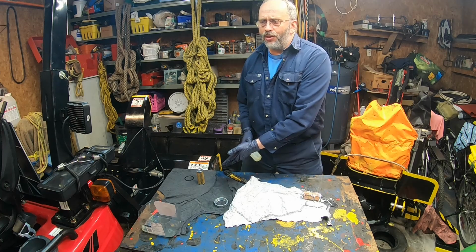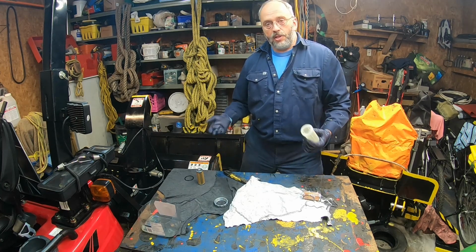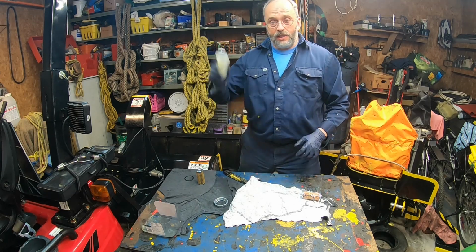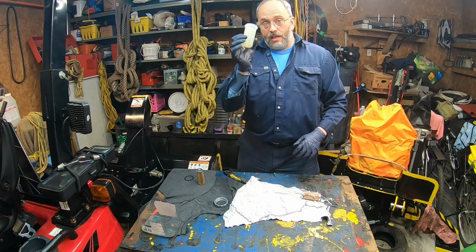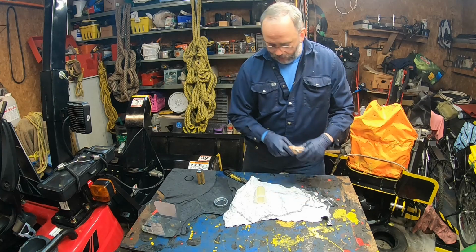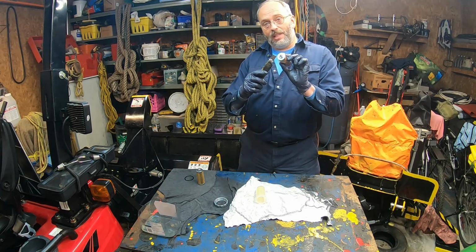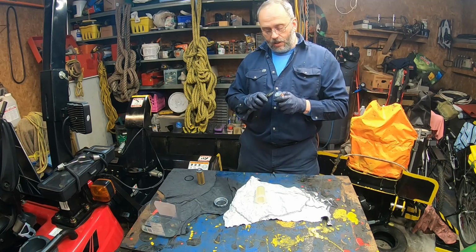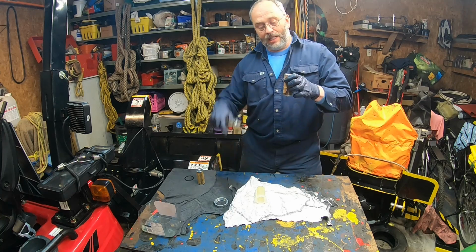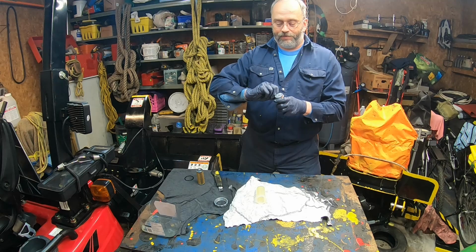But hey, I think I have 492 hours on my tractor, and you see the fuel filter, how clean is it? That's the reason why it pays to do the 100-hour cleanup. Now this is the canister, so I'm going to put the O-ring all around. I don't open it from where you connect it. I'm just going to work from the bottom of it and put it down so no dust will go inside the fuel filter.